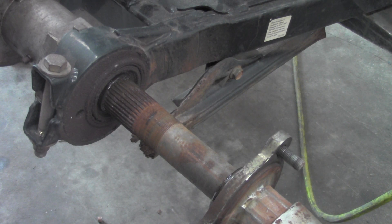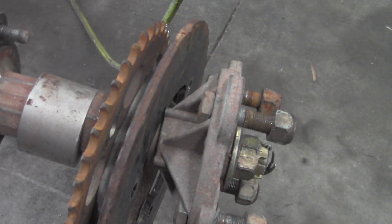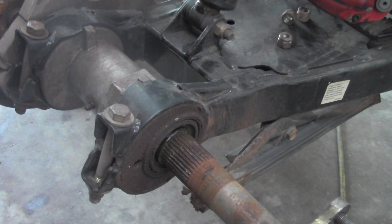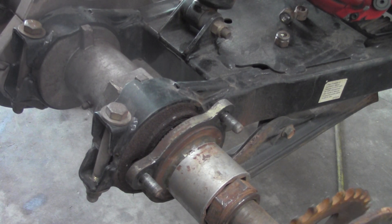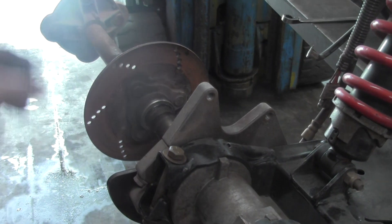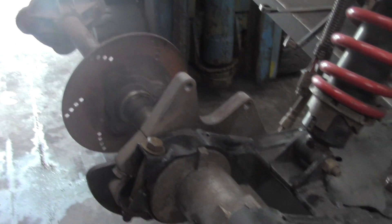At this point, if all you're looking to do is get into the bearing carrier, you would take off this hub — which is this castle nut and a clip. That axle will be free to go right off the other side. If you're looking to take everything off the axle, the other side is just the same thing, other than if you're working with a brake rotor rather than that rear sprocket.